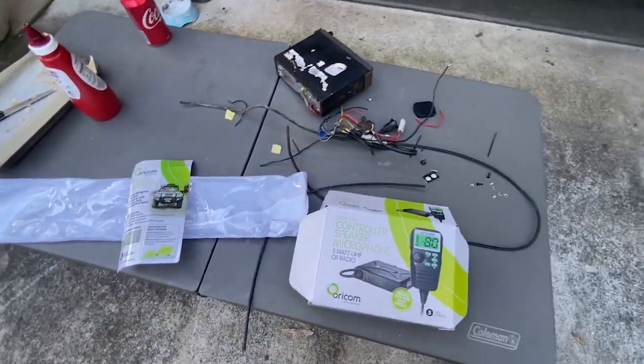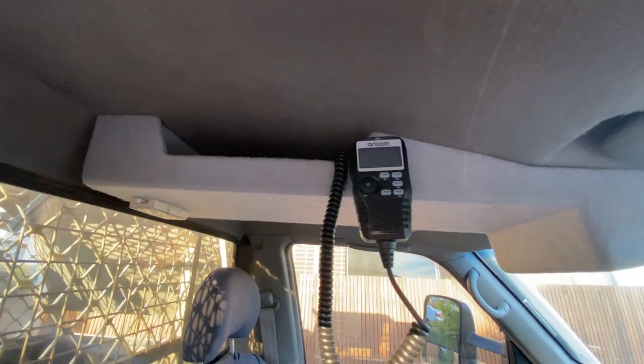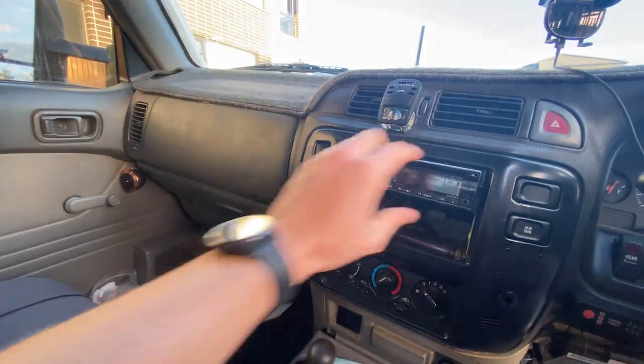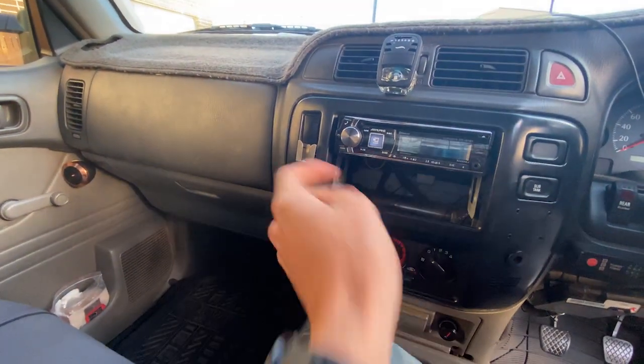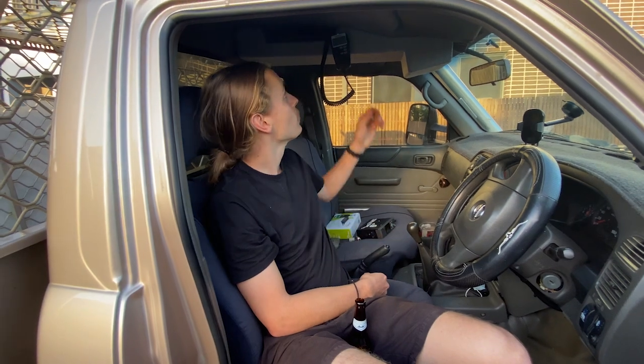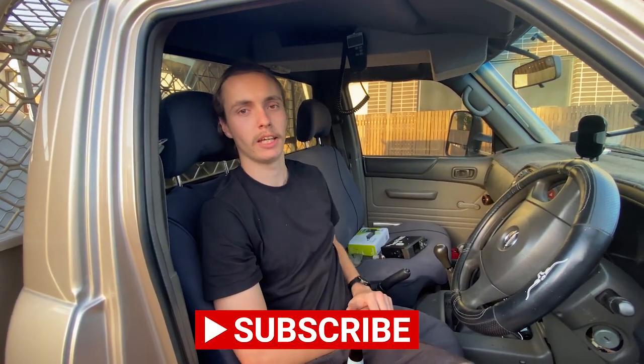The UHF antenna is all installed now. It only took a couple of hours but the most fidgety part was clearing up all the old wires. We've got the single DIN radio here and the gap where the old UHF was - what I'll be doing soon is ripping that out and getting a double DIN touch screen, which gives me more room and features like Apple CarPlay and GPS. The UHF up here is great - it slots off so I can change the channel and volume on the handheld. The actual unit is mounted up in the cavity like we showed you, with the speaker and microphone. We tested it all out, it all works, and I'm really happy with it. Thanks for watching - like, subscribe, and keep watching the videos.